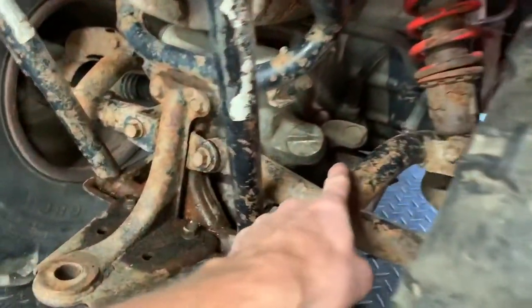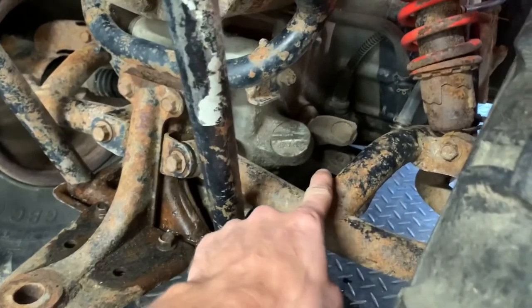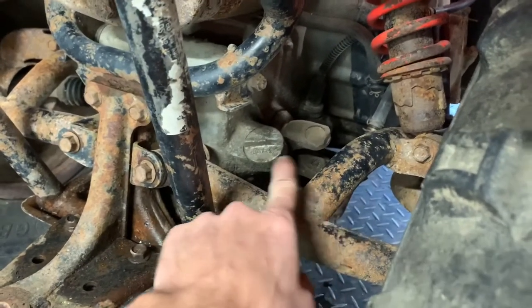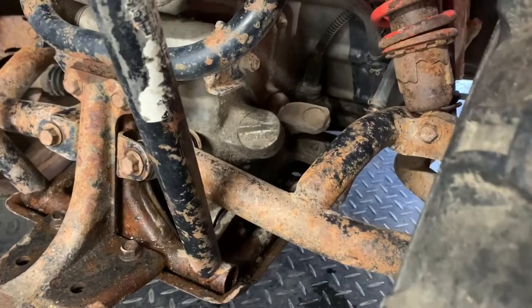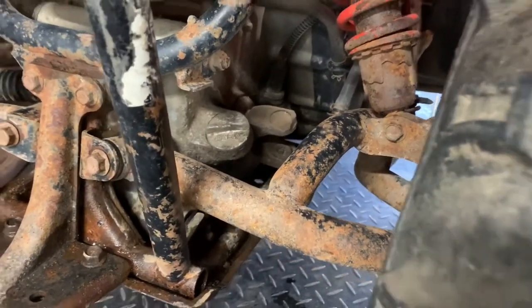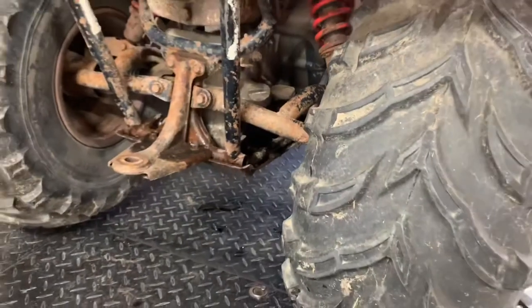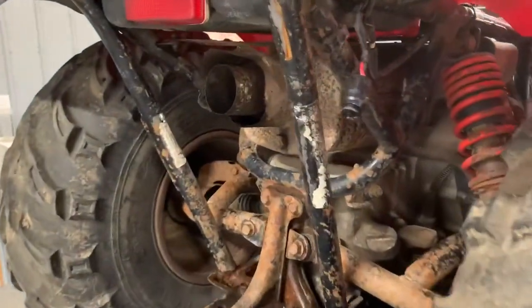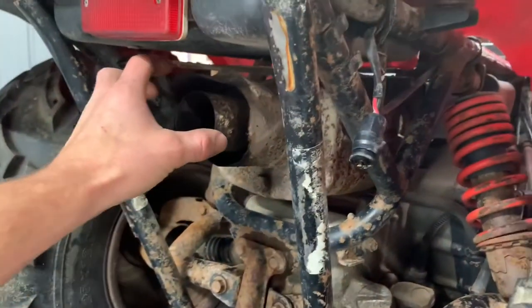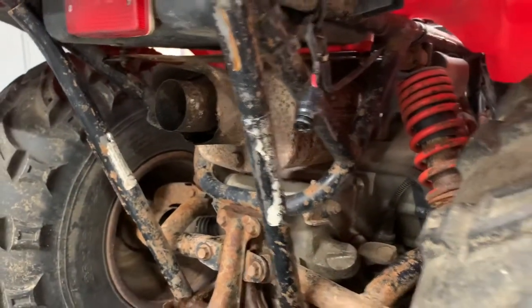You can see we've got a broken axle here in the rear — a U-joint failed and they've pulled that drive shaft completely out to allow this four-wheeler to continue running until it can be brought in and fixed. Also on the rear, we've got a muffler that's pretty destroyed. We want to make sure this is in better condition before we send this customer out on the trails.